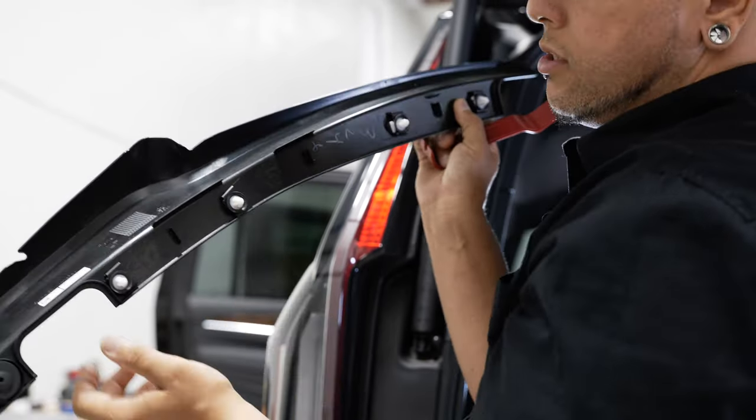Now that this panel's out, we're ready to remove our camera and our Cadillac emblem and liftgate button. To do that, we disconnect our wires — there's a little red security tab, press the button in the center and remove that. You have this camera line that we'll be removing and replacing — we'll be taking this one off this housing and installing it into our new one. Lastly, we remove this cable connecting our liftgate button. Same type of little red clip, pull the clip to the side, press the button down, and these pop right out.